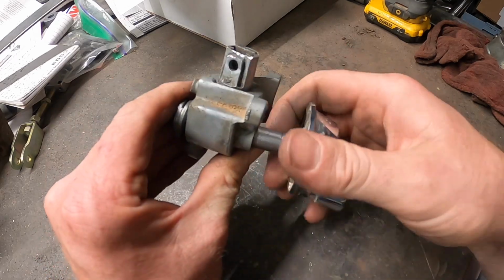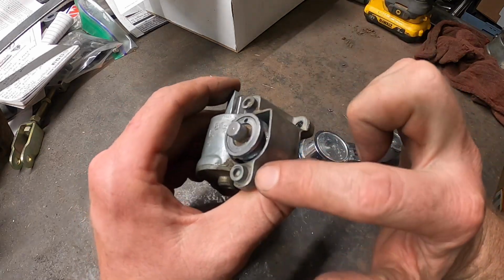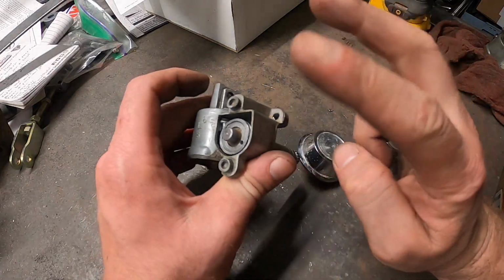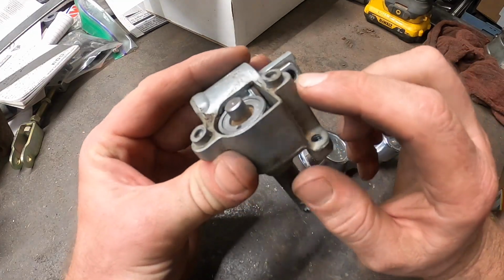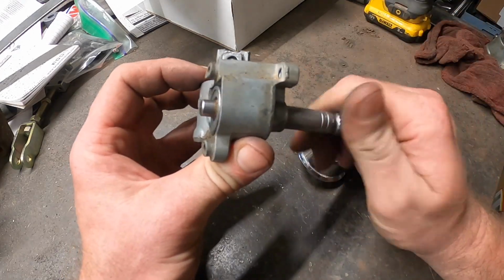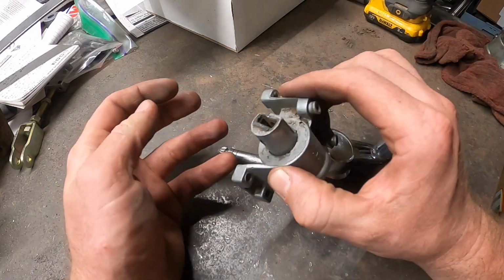The problem was, when we would spin this, the worm gear was just trying to push out of the back. Now this is supposed to have a plate across the back that would hold this worm gear in. 3 holes, 2 to be riveted in, which is just a cast pot metal body, obviously not very strong, and the rear plate just popped off of it, now allowing this worm gear just to fall out, not move our window, not do its job properly.